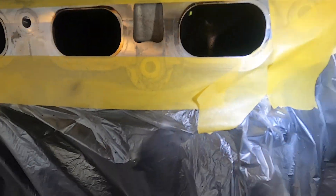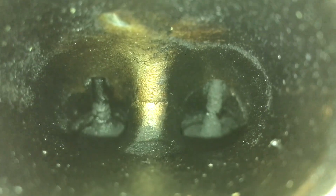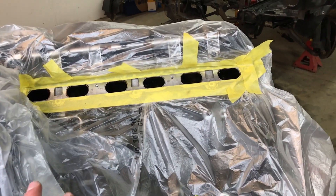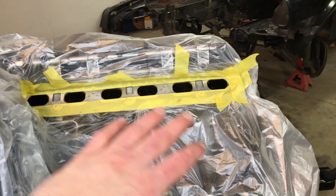If you can see in here — looking at the six cylinders on this now fully covered engine reveals that the cylinders are in pretty bad shape. That's six, that's five, that's four, that's three, that's two, and that's one. N54s have terrible carbon buildup on the intake, so we're going to blast them. We've confirmed that all six cylinders are bad.